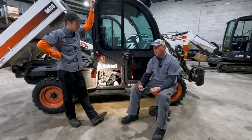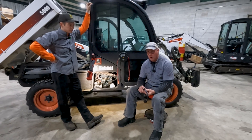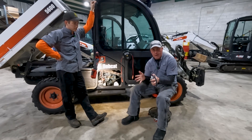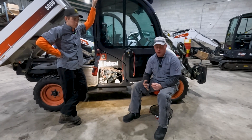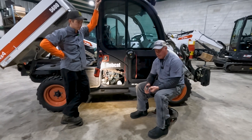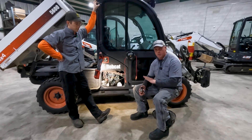What's the difference between the two circuits — what controls the pull and what controls the hold? On this machine, the controller controls both the pull and the hold. The pull is high current — a lot of amps — so it's just a momentary, like a one-second trigger to pull it in, and then the hold takes over. On this machine the panel controls both those circuits, though that's not always the case. Some machines the hold will be off the ignition and just the pull off the controller. On this particular machine, because the pull is high current, it has a fuse and a relay. The hold comes straight from the panel with no interference all the way to the hold wire.